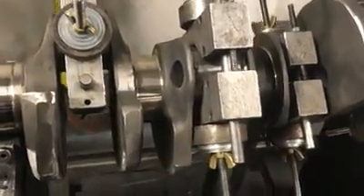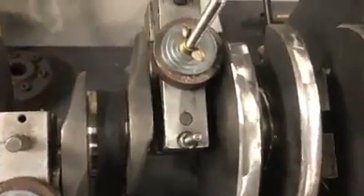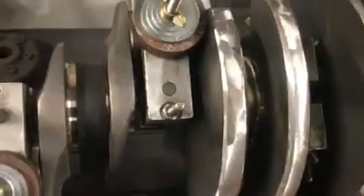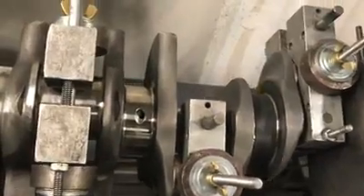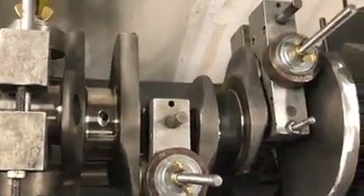This is just a little bit of what goes into building a Titus engine — or any engine that we build here. This is just one of the things we do as far as how we balance a crankshaft. I don't really like drilling big holes in the end of the crankshaft because to me it sort of acts like a paddle wheel, and guys spend a lot of money on windage trays and oil pans to reduce windage. It doesn't really make sense to add it back in.